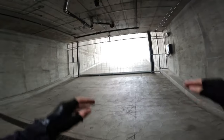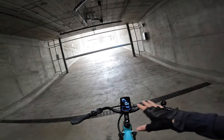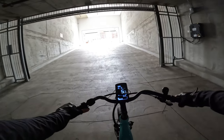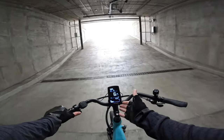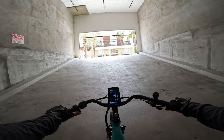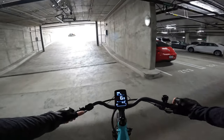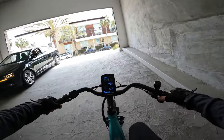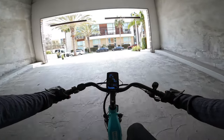Kicking off the review with the 20% hill grade test. This bike does have an automatic light-sensing headlight that turns on and off based on ambient light — a feature you can disable in the menu. We're on full charge, pedal assist five, thumb throttle only. I weigh 200 pounds. This is a very steep hill and the power ramps on slowly. It doesn't quite do the 20% grade under throttle only. So if you need a steep hill-climbing bike, you might want the mid-drive upgrade. With a little pedaling in gear one, we are able to get up the hill. Getting a bit more of a head start and letting the power ramp on, we're making it up the 20% grade.